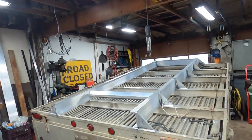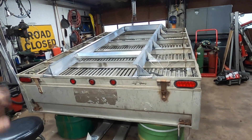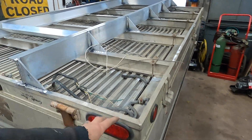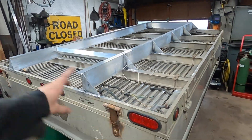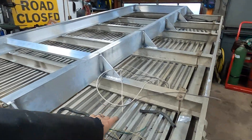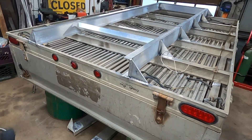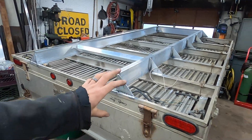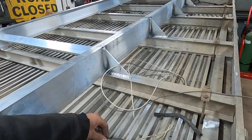It's a new day — today is the day. We were going to flip this outside and get it up on the truck frame, but it's raining, so I'm going to mess around with the lights instead. Long story short, all the lights for the truck bed were not actually wired into the truck's wiring harness. Instead, they were spliced into the seven-way for the trailer harness — all the trailer light circuitry as opposed to tying them to the OEM lights. So that's going to have to get redone.